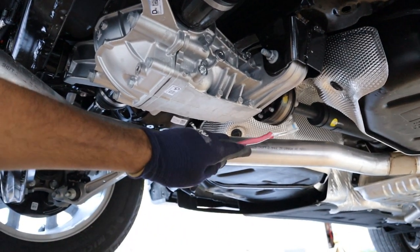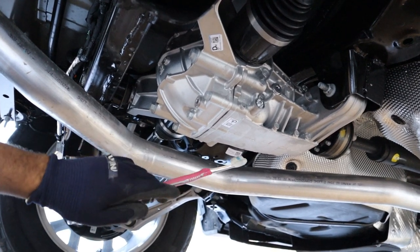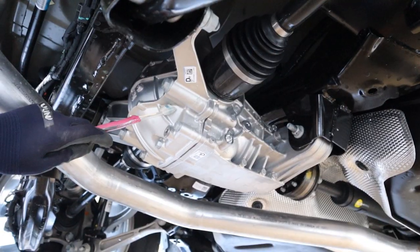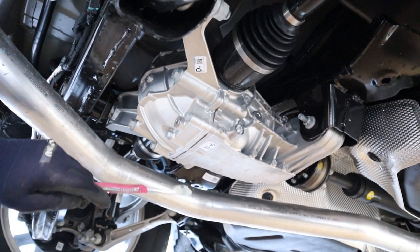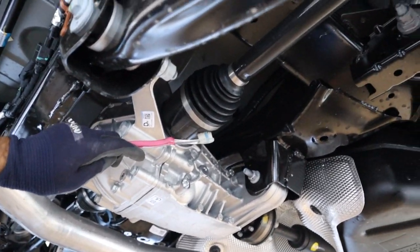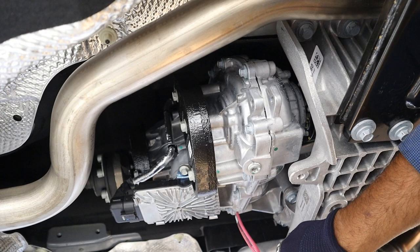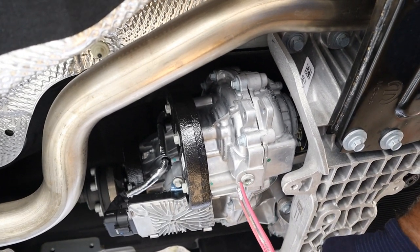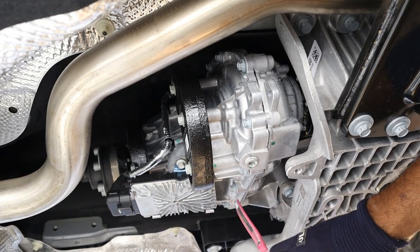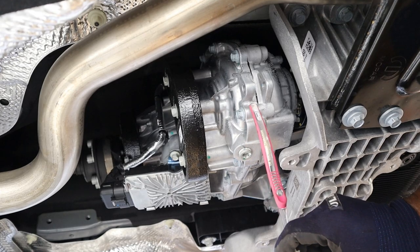All that torque is sent down that driveshaft to this rear differential, which takes most of the torque out to the rear wheels. There's a drain and fill for the fluid inside. This being the soccer mom spec, it's probably just an open differential. The power is then split between the two CV axles that go out to either side. This here is the transfer case, and it transfers some of that power out to the front wheels for your four-wheel drive or all-wheel drive system. On this grocery getter model it's almost an all-wheel drive setup because there is no lower range mode in this transfer case.